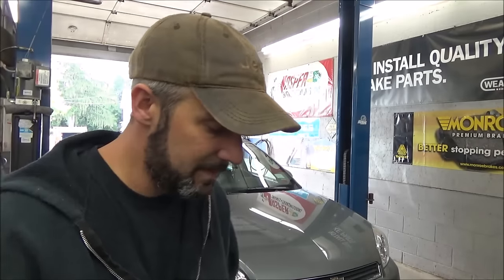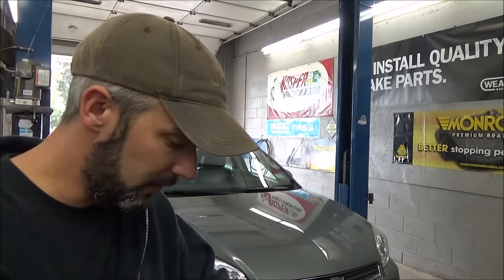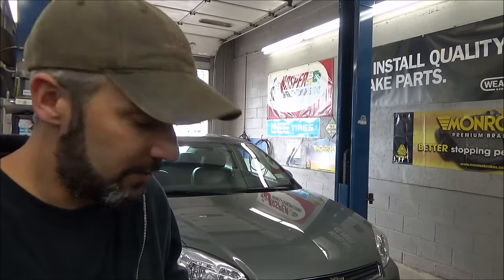There you have it — a pretty fast and easy way to do it if you don't have access to a TPMS tool. We use these tools because we do so many different makes and models and the procedures are quite different, sometimes requiring OBD2 programming for new sensors. But GMs have always been the same ever since they've used TPMS sensors — cars, trucks, everything. So if you rotate your tires or replace a tire pressure sensor, that's how you do it. Check us out on Facebook, connect with us on Google Plus, and remember: if I can do it, you can do it. Thanks for watching.